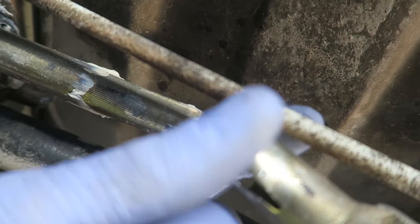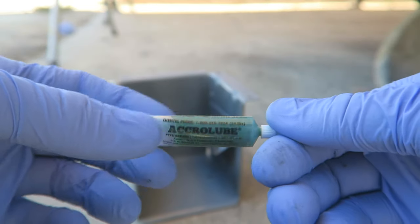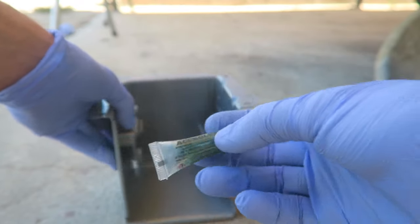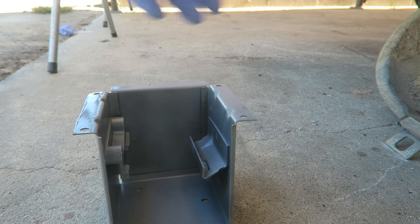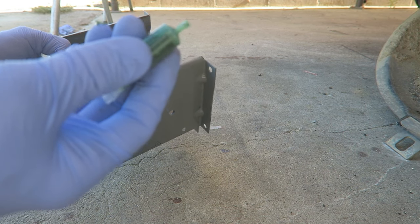I just slid the front rod back through and through this new bushing right here — this is where it connects. I got to straighten this out and then put that little shackle around it and we'll be good to go. GoWesty includes some lube for the shifter box and for those little shifting ring thingies. I'm going to go ahead and use this, applying it right here on the inside and over here. I'm going to put a little bit of what's left on the shift fork itself.